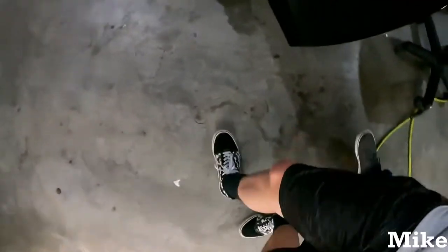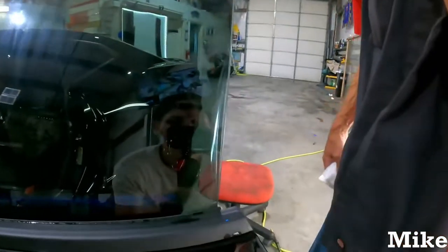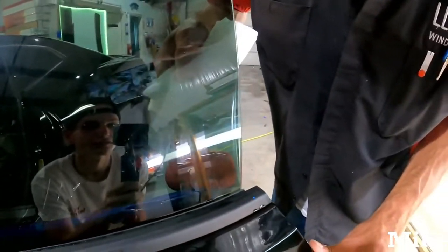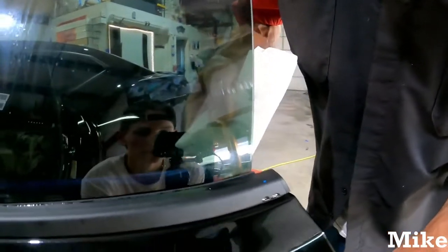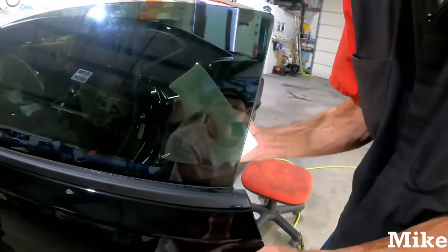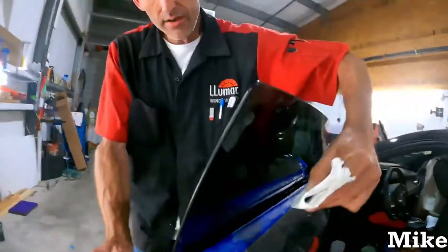I'm running. Okay. On the other side, remember when I was telling you about heating the back edge? It gets you like this right here. That's what it'll do if it gets too hot too fast. Because, you know, your boy doesn't like to wait. Stuff happens. So you just come back, slowly push it down. I'm going to get the glare out. Slowly push it down. Now, if it's still hot, it may or may not pop back. Angle your hard card, squeegee, whatever. I always find that a hard card with a paper towel is a little better, just in case there's any moisture that comes out.